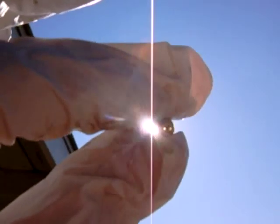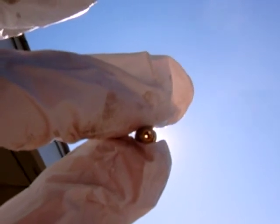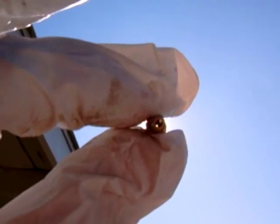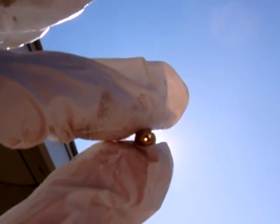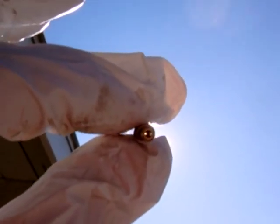What I'm holding here is the slow jet — I removed it, and you see that little pinhole? Directing it against the sunlight, this hole is a little clogged here. You want to clean it out so that the light can pass through that orifice.